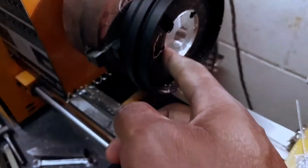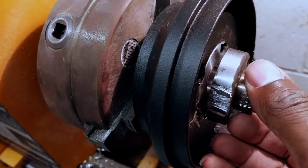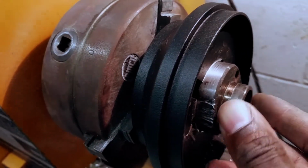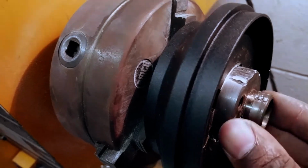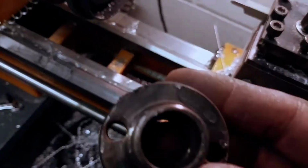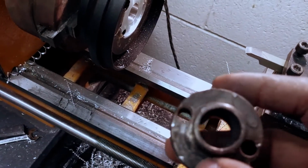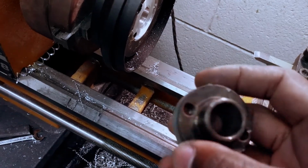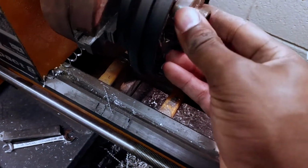Alright, so I've gotten everything machined off, and I went ahead and did a preliminary pass for my final cut. So this will basically fit in there, like so. Obviously, just need to make it a lot deeper. That should be pretty good. So let's make that a lot deeper. Go ahead and sink this all the way in there. Then I'll drill out the threads in here, drill two more holes, and go ahead and countersink this guy so I can fit some Allen heads in there, and then I'll tap this guy, bolt it in from the back.